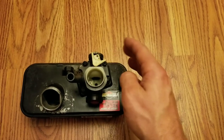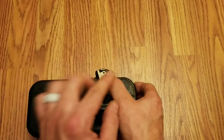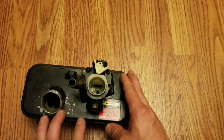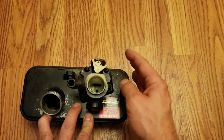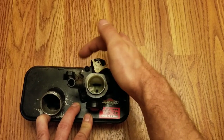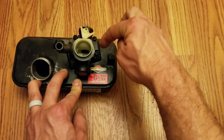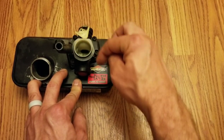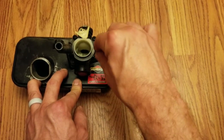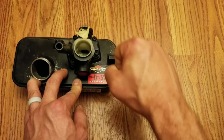Now to finish this off, all I have to do is screw these down. This carburetor needs to be seated against the gas tank very securely and evenly. So when putting this all back together with your new diaphragm, you need to make sure you screw just a little bit here and a little bit there. This is a star pattern — so you're going one, two, three, four, five — go around that star pattern because you have five screws. Slowly ease it down: one crank here, one crank there, little at a time. Ease it down and then on the final pass make sure it's good and tight.